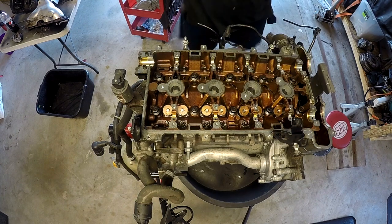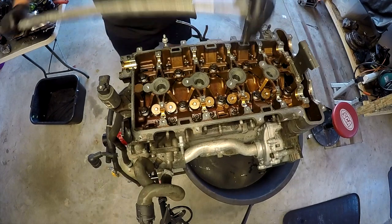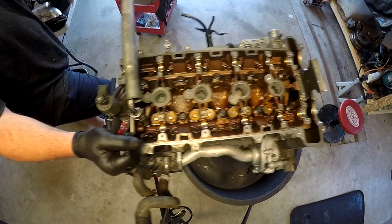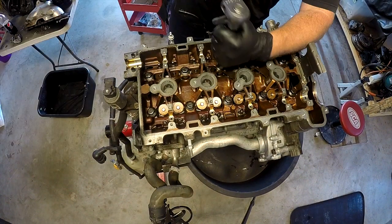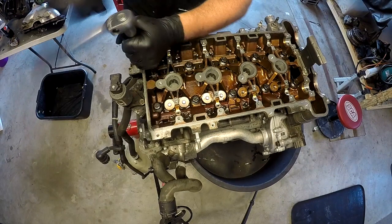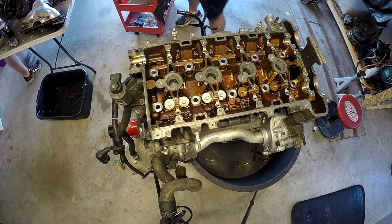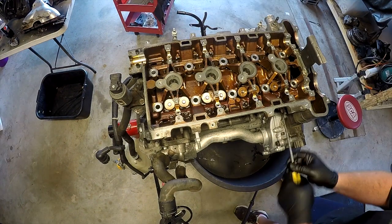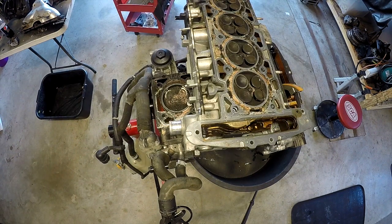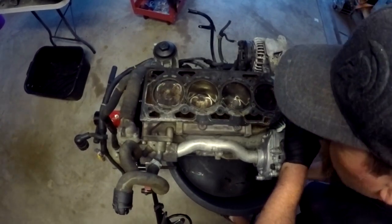Here I am trying to pick up all the pieces of what was left of the rocker arms. Now removing the cylinder head bolts — I couldn't find my breaker bar so I've done the old trick of a piece of pipe over the end of the socket. With the head bolts out we pulled the head off to see what damage we've got. A quick glance shows that all those valves are still sitting open, meaning pretty well every single one of those valves has been bent.